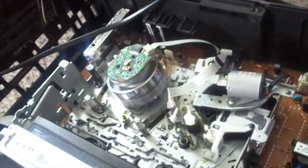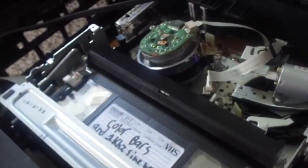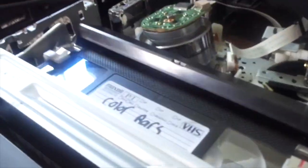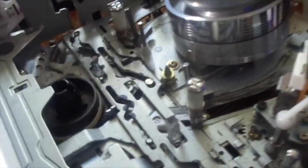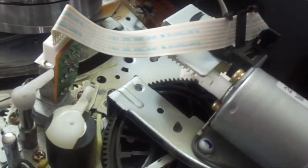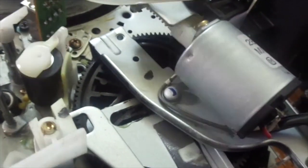I'd like to try this Mitsubishi VCR remote - see if this remote does anything. I'm going to put this tape in, leave it in stop mode and see if I press play... there's no batteries in there, so we'll test it later. One more thing - the ejecting mechanism. There's some sort of sliding plates here. The pinch roller - the white part - is very similar to the Panasonic. The mechanism with the motor placed there, but with the pinch roller that doesn't go down. The Panasonic also has a sliding plate like this on the top side.